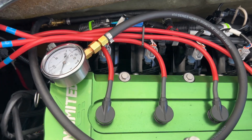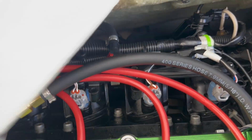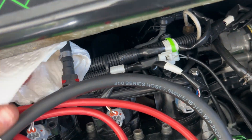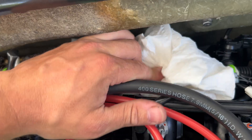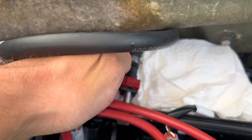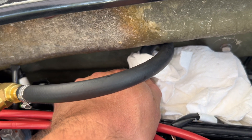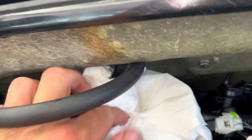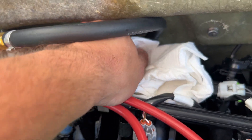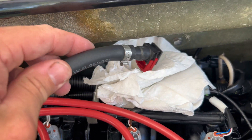If you want to get this gauge off and don't want to wait for the pressure to go down, I'm going to show you a quick trick to bleed this pressure off. Put some rags under the fuel rail. I do suggest you let it bleed down on its own, but if you're in a hurry, you can see we're still at 20 psi so this will squirt a little bit. Pop this connector up — it is under pressure. Move it very slowly and the pressure will bleed off. There we go — you can see we are no longer under pressure. Had my rag there. Don't let it squirt in your face — use a rag. You can see quite a bit squirted out there.